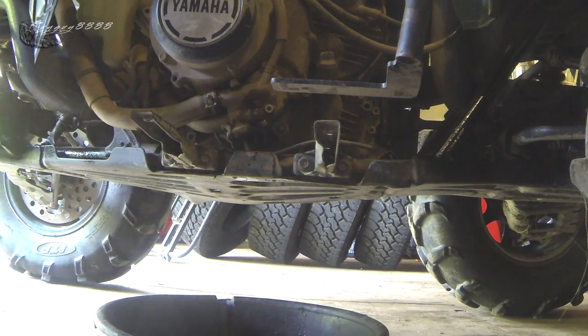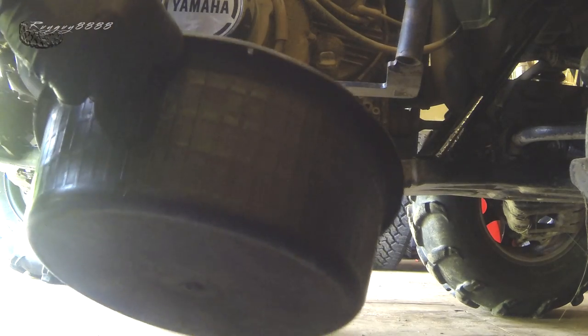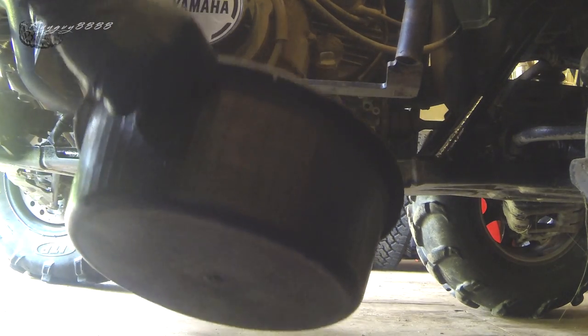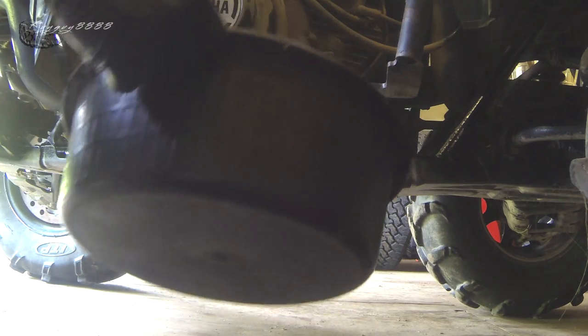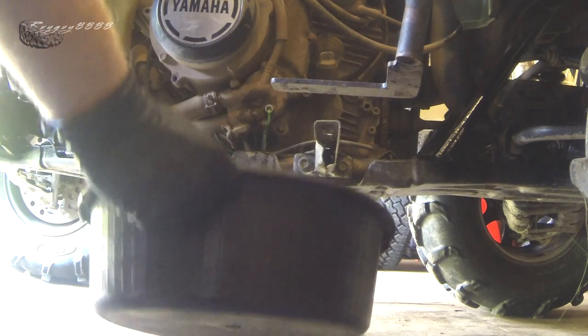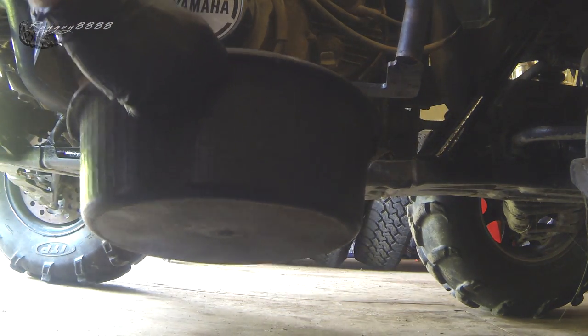What I'm going to do before I crack the top end of the radiator is break that vacuum — it's an eight-millimeter bolt, and be careful because this is very, very soft aluminum. That's all it took to get that off. Not a lot is coming out of there, and you can access the radiator cap right from here. You want to be careful because sometimes this is going to spray right out of there, so I'm just going to slowly open this up.